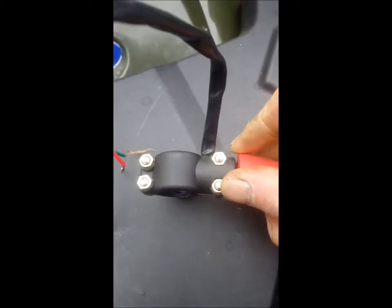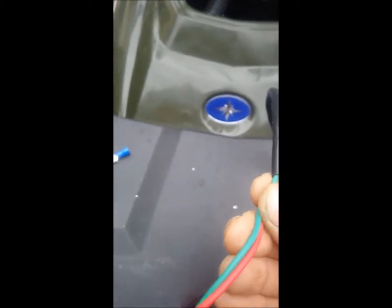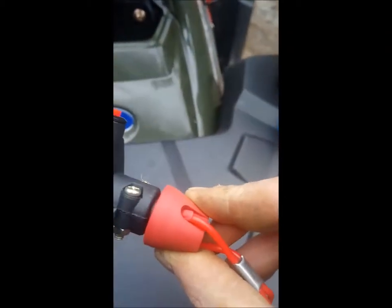But if you have bought a Type A in error and don't have enough time to sort it out, this is what you need to do. You need to cannibalise it for the parts. You're going to need this tether here, and this plastic unit. Take these four screws and nuts out. If yours is fitted with an additional switch, you can lose that as well. You need to take the switch out of here and retain the wiring loom — all the shrouded plastic and the two wires. Take it all apart, cut the switch off at the end. You can get rid of the little red switch on the end because that closes the circuit. We want to do the opposite. You're also going to need some spade connectors — both male and female types. They come in various sizes; because you're going to be pulling something out, I would go as big as you can. You're also going to need your soldering iron and soldering gear, and a few pairs of pliers and some electrical tape.